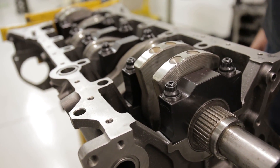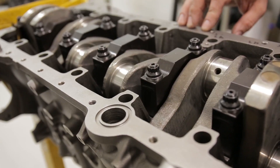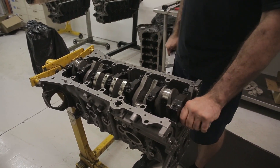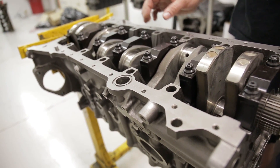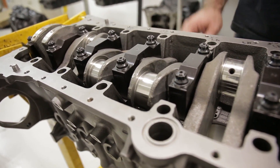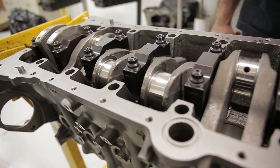So today we're going to show you real quick how to seat your thrust bearing. If you have an engine where the main caps are not doweled, or if it's not a bed plate style engine, then this is something that can help you. Basically the thrust is located in a main saddle in the block off of its hardware, but there's some wiggle room in how the cap can locate into the block. So it's important that you seat the thrust bearing before you operate the engine.